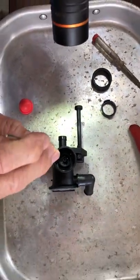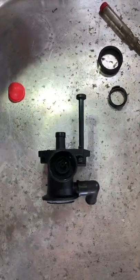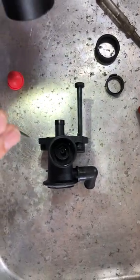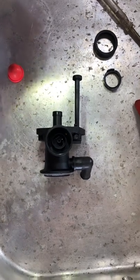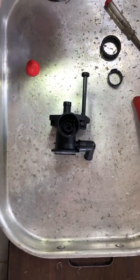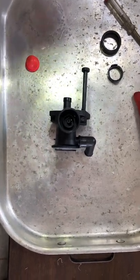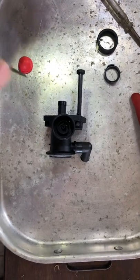You think, oh, I'll fix that. This is the order it goes in: you put the spring in, then the ball, then the needle seat on top with the ridge side up, and you think it's repaired. Then it all falls apart again inside the bulb and you're right back where you started. So in case you're wondering why your Chinese carburetor won't prime, that's why.